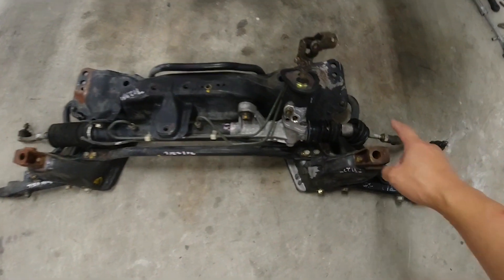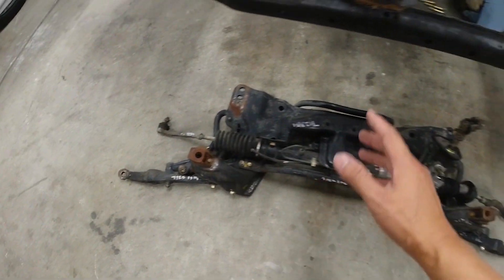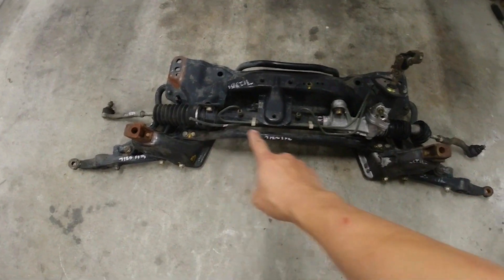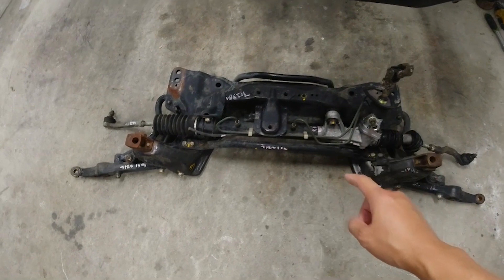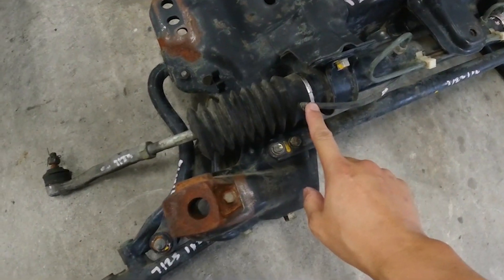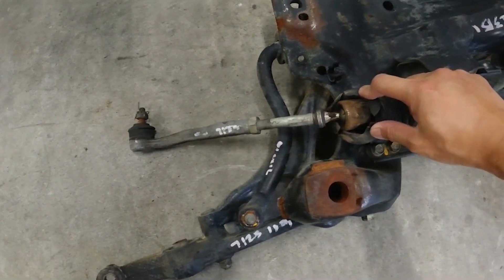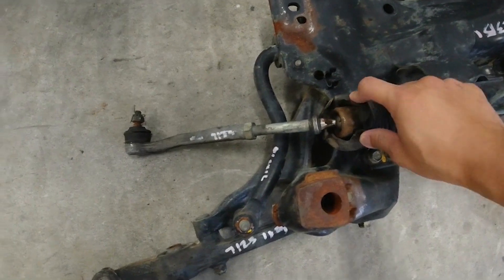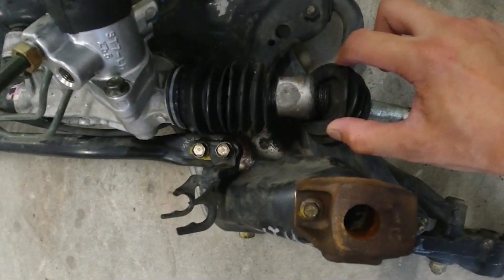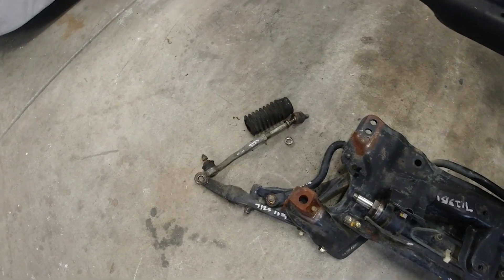The first thing I'm going to be doing is taking off the inner and outer tie rod ends on both sides. I've already bought replacements, so I won't be needing them. And I'm going to leave the power steering rack attached to the subframe so that I can pull these parts out. In order to take these off, I'm going to have to disconnect the line right here and pull off these straps. You can see it's already pretty bad down there because this thing is over 20 years old — really bad. So these things need to be replaced anyways.